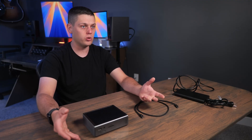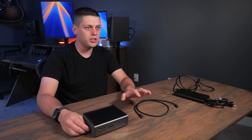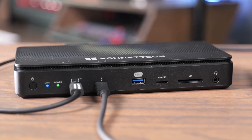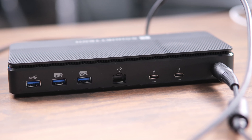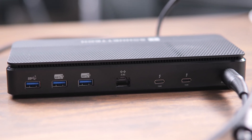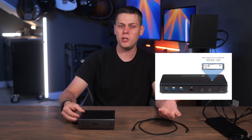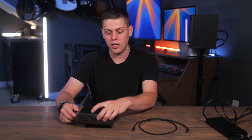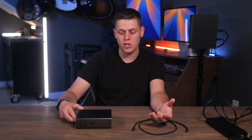When trying to decide which dock, make sure you look at all the different devices you're already using, everything you need to keep plugged into your computer, and compare to pick the dock that fits your use case best. Really, the only other dock I would consider over the TS5 Plus right now is the Sonnet Echo 13 SSD dock. That one has a couple of trade-offs: there are fewer USB ports, but one additional Thunderbolt port, and it's made of metal and also has DisplayPort. Where the Sonnet really thrives is its built-in SSD, though depending on the SSD you choose, that will drive the price up. So it's up to you — if you need the 10 gigabit port and the CalDigit build quality, go CalDigit; if you want the built-in SSD, consider the Sonnet instead.